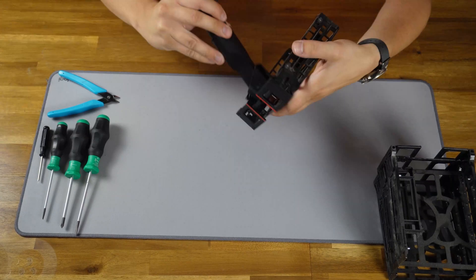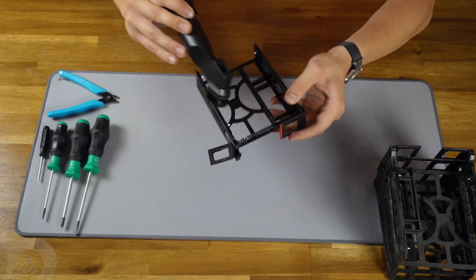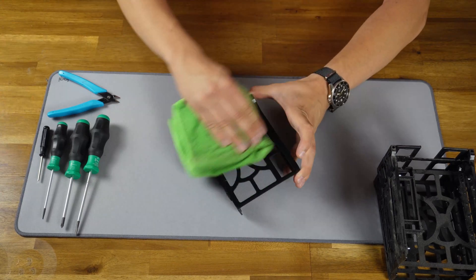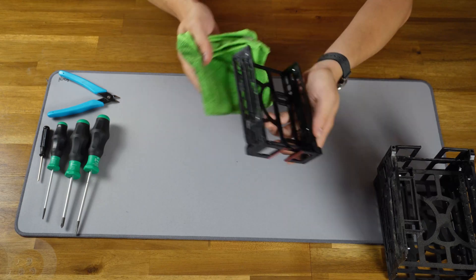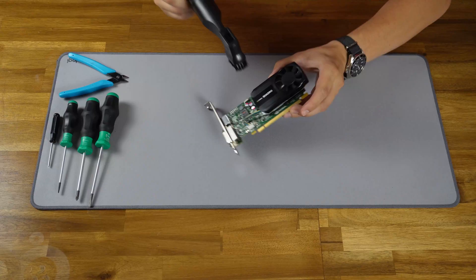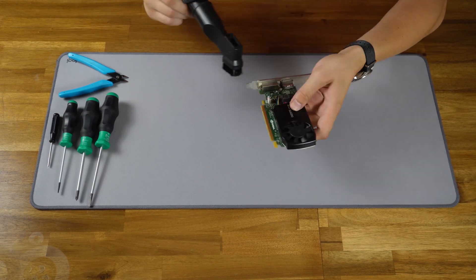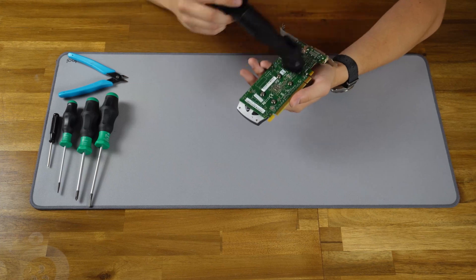I cleaned all of the individual components before starting the reassembly process. These hard drive bays are pretty cool. They hold 2.5 and 3.5 inch drives and the drive insertion is tool-less, as well as the insertion of the drive bay into the case. The SSD is new — it was a gift from the reseller from which I bought the workstation. I cleaned the GPU as much as possible from the outside before disassembling the cooler so that I can clean it thoroughly and change the thermal paste.